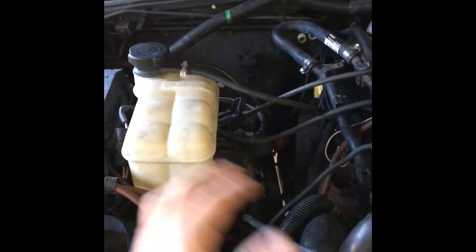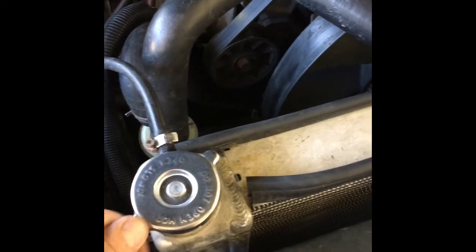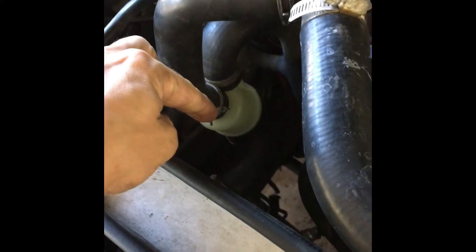Heading back, I saw the car was overheating again. I thought I had to purge it — get the air out of the system — so I did that. Everything worked for a day or so, and then the car started overheating again. I couldn't figure out why. I kept filling it up, worried about a blown head gasket. I did find a little tiny leak, but that doesn't affect it too much. Then I realized the top hoses were hot but the bottom hose was cold.